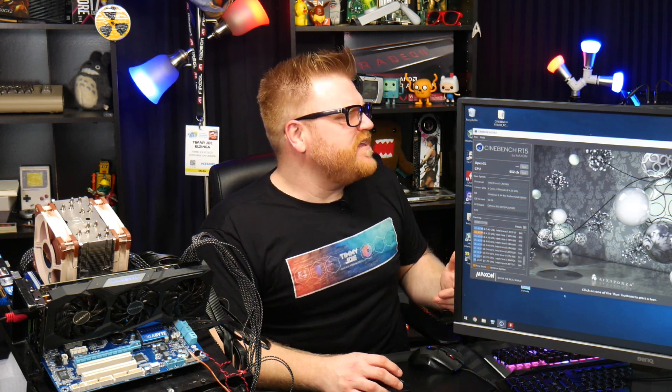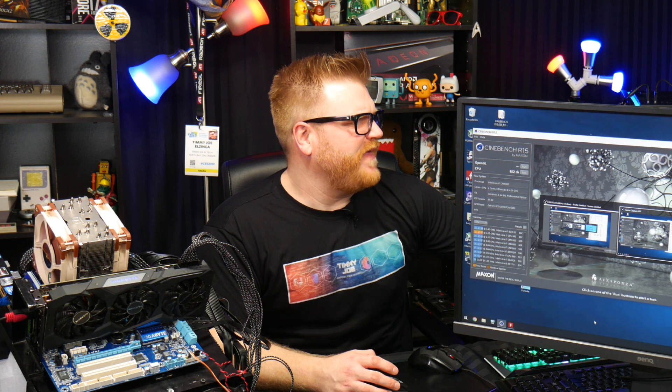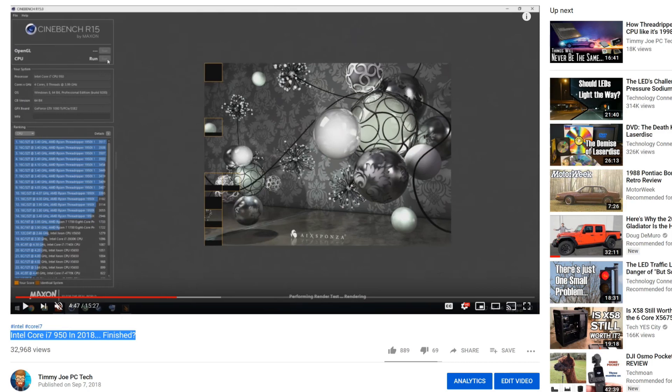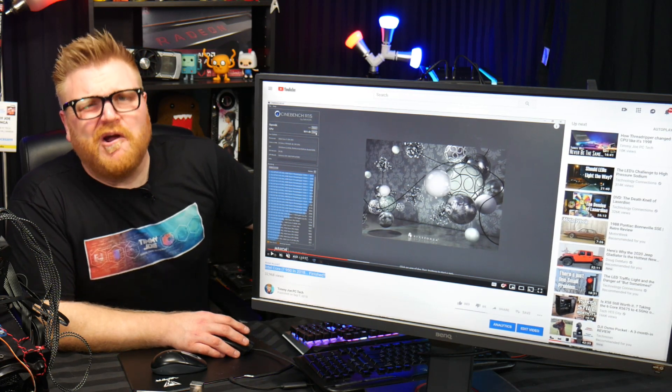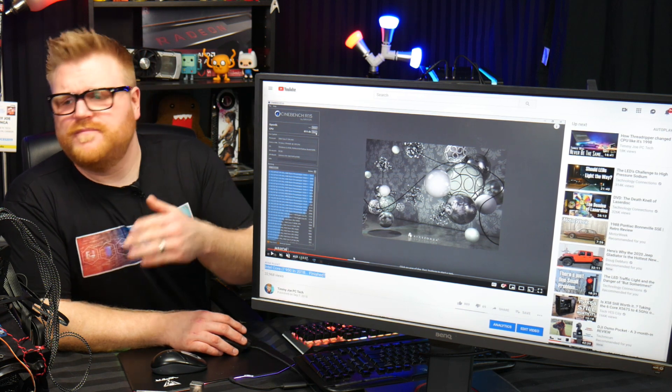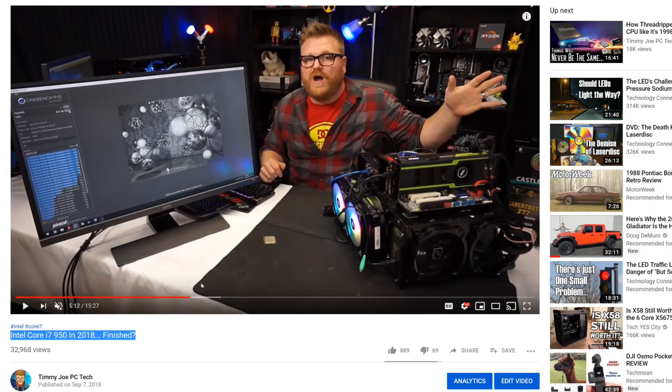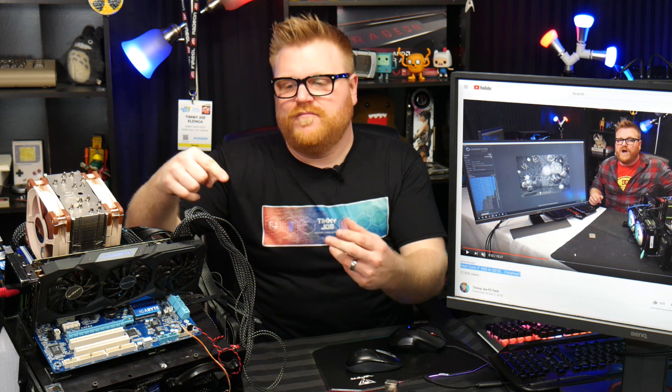So how does it compare to the Core i7 960 — basically its brother but on the X58 platform? I have my old video up here — it's actually the 950 I reviewed. We got a 611 and I was only able to hit four gigahertz with that processor. It's the same 45nm manufacturing process. But on my test bench there I'm running a 1080 Ti and a really big 280mm rad with a Gamer Storm AIO, so I'm able to get better performance on this 800 series i7 than I was with the X58 version. I know I won the silicon lottery here, but with a much better cooler — that's why I'm so impressed with this.